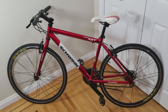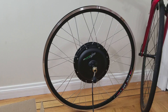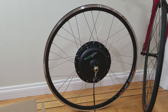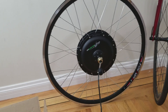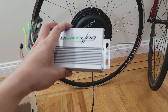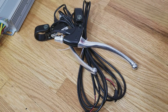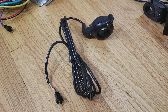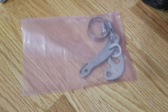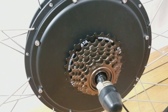I'm going to show you how I convert my hybrid bike into an e-bike. The kit I chose is an eBikeling kit from eBay — a 1200 watt rear hub motor direct drive, along with a controller. The kit comes with two brake levers, a pedal assist sensor, an LCD meter, thumb throttle, some grips, torque arms, miscellaneous wire loom, zip ties, and a 7-speed freewheel.